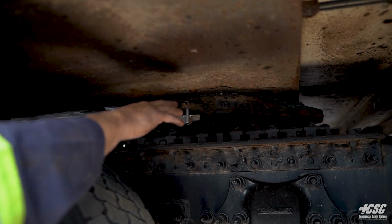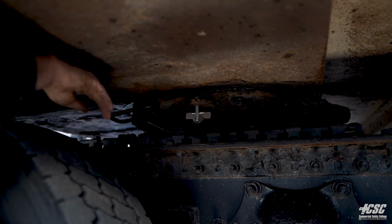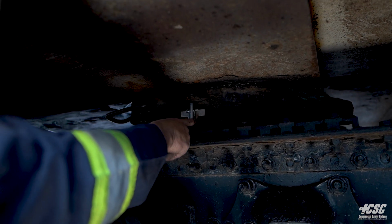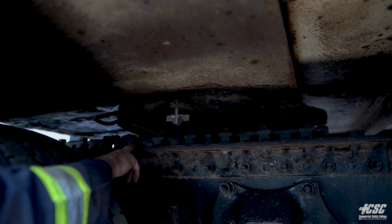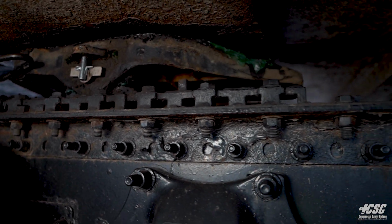We can see our apron plate meets our fifth wheel plate. There's no daylight showing through. Our release handle is all the way in. The security of our fifth wheel, we have a pin in here. It's all secure to the riser. The riser is secure to the sliding plate. We have the fifth wheel slide locks. They are in place to the table, and the table is securely mounted to the frame.